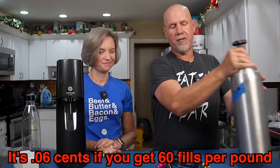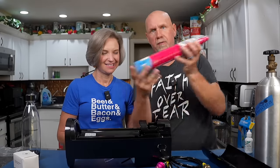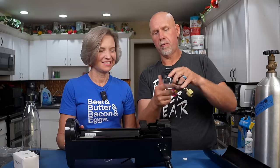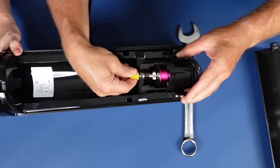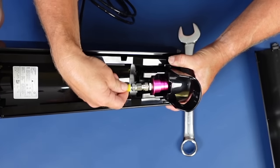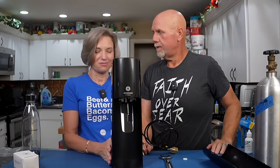Here's what we need to do. Take the machine and take off the back cover — it just snaps off like this. Normally you'd put the SodaStream cartridge in here, but instead we're going to take our hose, lift up this little piece, and drop our adapter in. There's a little yellow slot right here where it slides up. We put this in here, push and go down like that — now it thinks there's a bottle in there. Your SodaStream is modified. That's all you have to do.